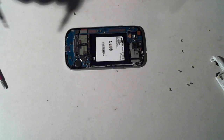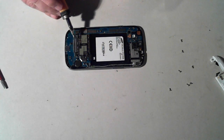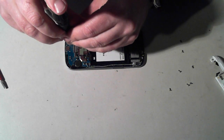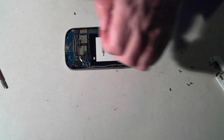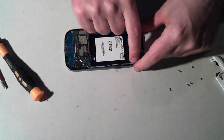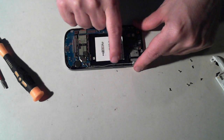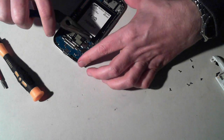The main board is held in by one more screw, which is a black screw just down here — remove that screw. There's also what is probably either the phone antenna or the Wi-Fi antenna, which has a little connection there, so just carefully remove that.